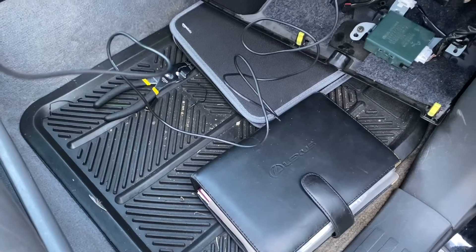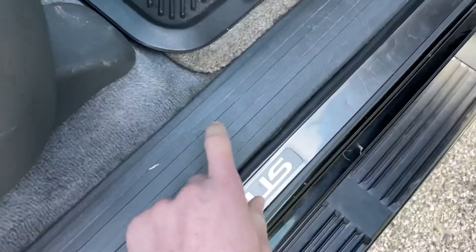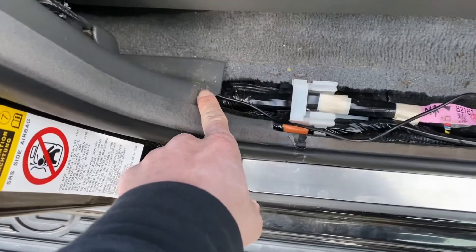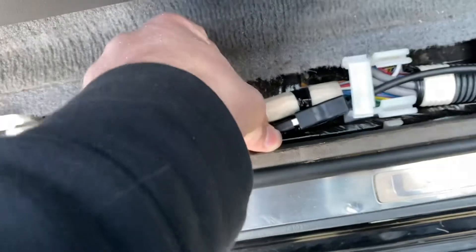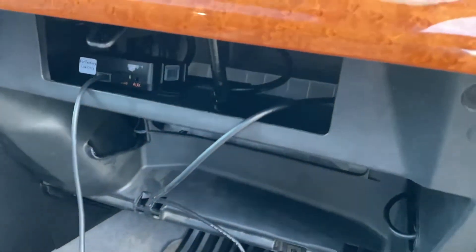Back out with the Lexus after work. I have a new USB extension cable — the gray cable was definitely long enough but it was way too long, so I bought another one that's about four feet shorter. I'm going to run that under and see how much excess we have. The dashcam cable runs from the back, tucked in the door sill, then underneath here. I'm putting the trim back on top, tucking the connection down into there, then running it off the side panel. Now there's a lot less extra cable — I'll cinch that up with a zip tie and use some 3M tape to remount the pad.